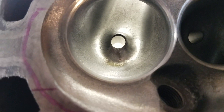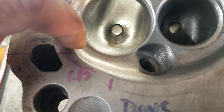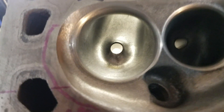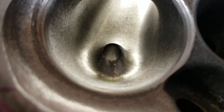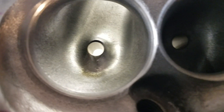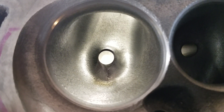The intakes are pretty much the way I really want them. I did do a little more work on DV's chamber. You can see this area right here has been brought out a little bit further. I did as much as I possibly could on the short side radius — it is what it is, it's pushed as far as I would like to. In fact, some of these are down to 60 thousandths as far as thickness in a few critical spots, so they're pretty tight.